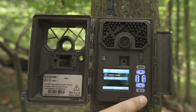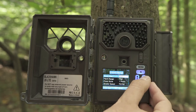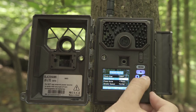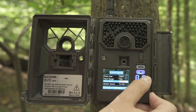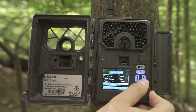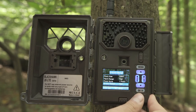To customize your camera settings, hit the down arrow and select OK. From here we have 3 megapixel selected; to change this, use the right arrow — you can go all the way up to 20 megapixels. Hit OK to save. To adjust flash range, use your left and right arrows to go between Low and High, then hit OK to save. To adjust photo burst, use your left and right arrows — photo burst means your camera can take a 1 through 10 shot burst every time the PIR is triggered, however the camera will only send the first photo. To adjust shutter speed, use your left and right arrows between Normal and Fast. Selecting a fast shutter speed will reduce the amount of blur on a moving object. Hit OK to save, then hit Menu to exit.